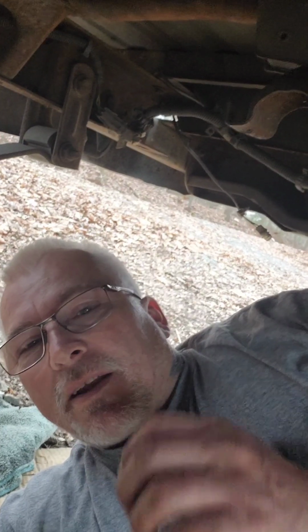It took about maybe 10 minutes, probably not quite, honing that thing, putting the bearing in the vise and just kept checking. That was the most time consuming thing, taking it out of the vise and checking it. But finally I got it to where I can slip it on and off of the pinion, and it's pretty good. I got the other bearing to go on it in the basement with the press, and I'll show you that process too. Or I could just heat it up and drop it down on there, but I like pressing it on the way it's intended instead of heating it up.